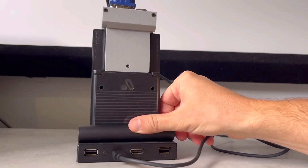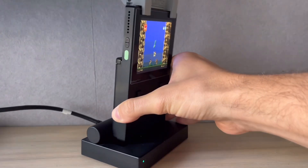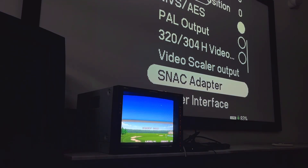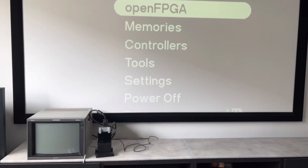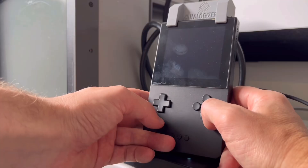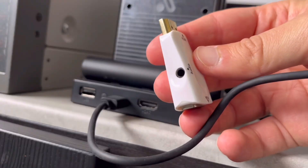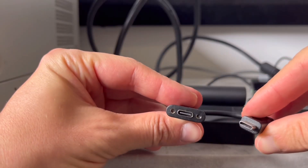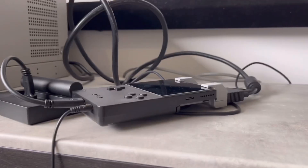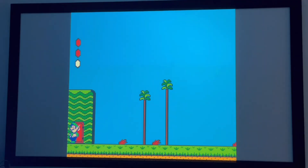If you have the dock that lets you sync Bluetooth and USB controllers to navigate the menu, well the Pocket screen goes to sleep when it's docked. You could simultaneously output HDMI to another display solely to control the menu, but docking the Pocket prevents plugging in an auxiliary cable. Workarounds include extracting audio from the HDMI port or using a fully wired female-to-male USB-C cable so the console is connected without being cradled, freeing up the headphone port.